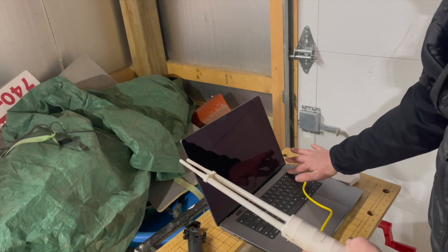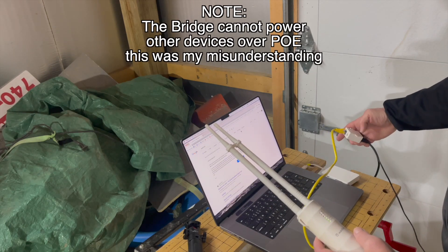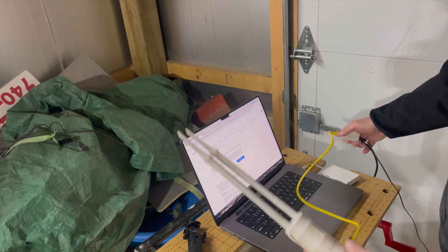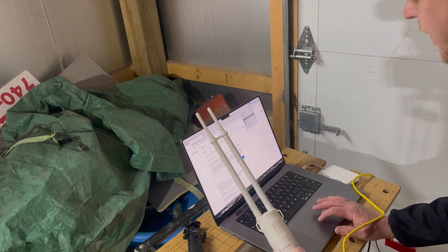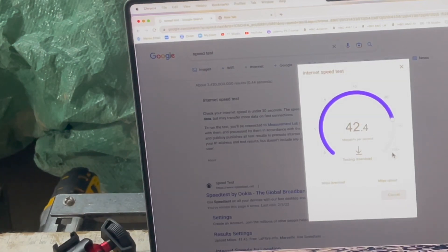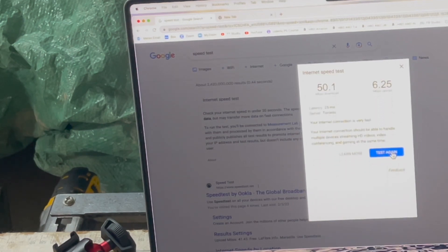Things got a little clunky — I was not getting power over ethernet to my access point. So I went ahead and put the power over ethernet adapter back on. We're coming out of the bridge into the LAN cable, into the power over ethernet adapter, which is plugged into the WiFi access point. We're looking for our WiFi access point — here we go: Wavelength AC, Wavelength. We're hooked up to the Wavelength, which is hooked up to the bridge outside. We got 50 down and about five to six up. Something's up with my configuration — when I hook directly to the bridge I'm getting much higher. But that's still pretty good.